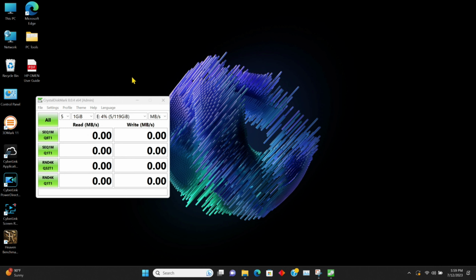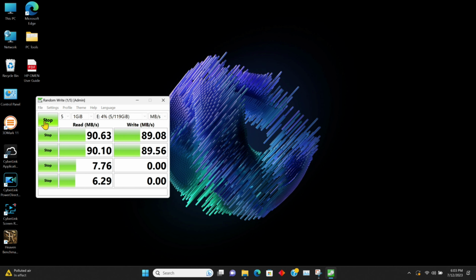In the third test, I took the exact same configuration, the high speed SD card going through a quick adapter to USB 3.0, and plugged that into one of the 3.0 slots on the Intpw device. Let's see what this does. Okay, there's negligible difference between this one and the previous test, so the Intpw is not adding any sort of extra latency to the two USB 3.0 ports.